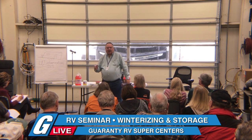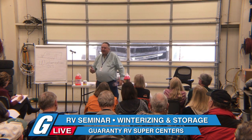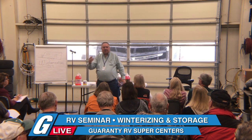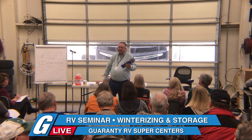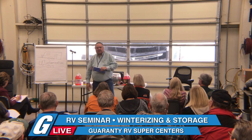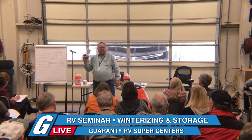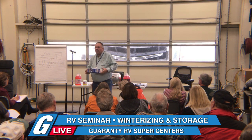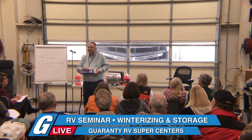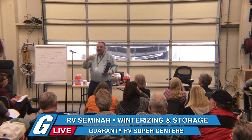And people ask, well, how do I know when my filter's full? And the answer is your water flow drops way down. As soon as you notice your water flow dropping down, put a new filter in, or at least once a year. When you winterize in the fall, you do not replace it. You take it out and you throw it away, because you do not want a water filter with garbage in it, wet, sitting there all winter growing, and then introduce it back into your system.